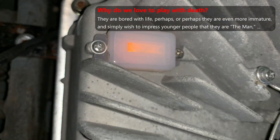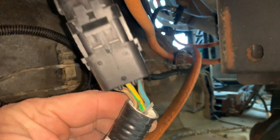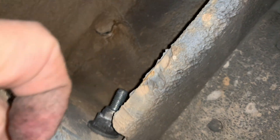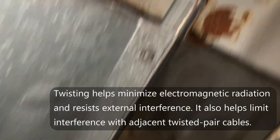I just moved that and then the light turned on and off — that's not very good. Moving it is causing it to flick on and off, so it's got a bad connection in that joint somewhere. That's 240 volts, so I probably should be careful with that. It is shielded in there, so it's not too bad. I'm not an electrician and I am not an EV builder, so I'm just looking at what I can see. There are also more grinder witness marks, and the Batrium cables going into that one are not twisted through the whole loom — I would have liked to see them twisted.